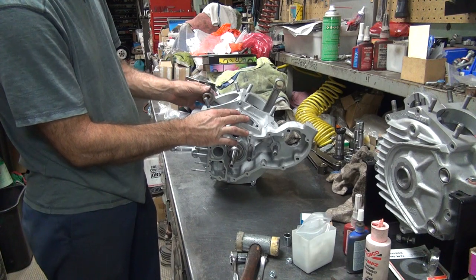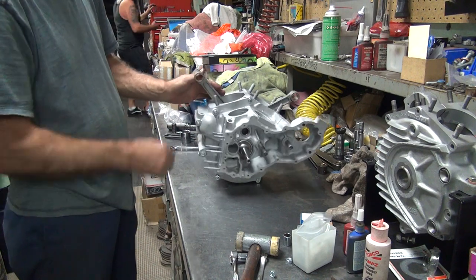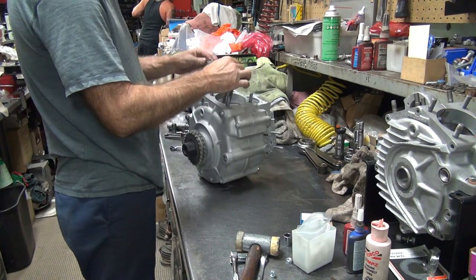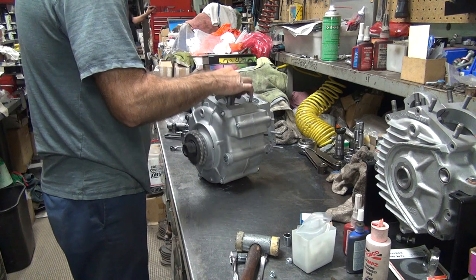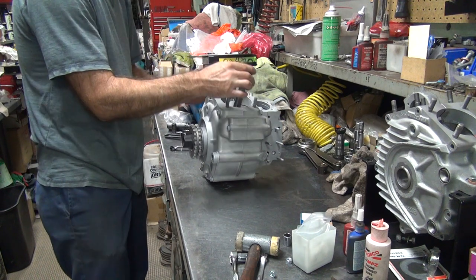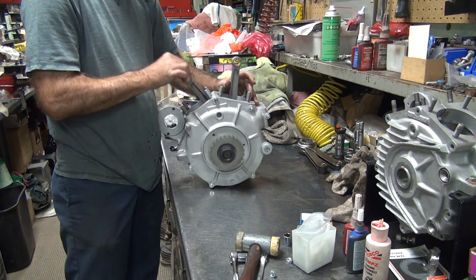So if the weight of the flywheel is moving it back up, you know it's not binding. And we got the seal on here too, remember it's engaged right now. And there's no lubrication on there either, is there? It's lube on the pinion shaft seal. Yeah, or assembly lube. See, that's probably a Harley sprocket. See how it's wobbling side to side, going up and down, like a lot of the aftermarket ones do? This one spins nice and straight, see?